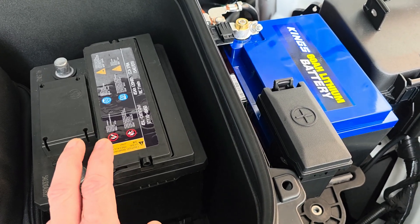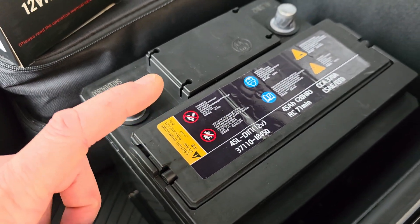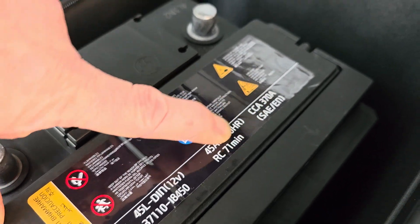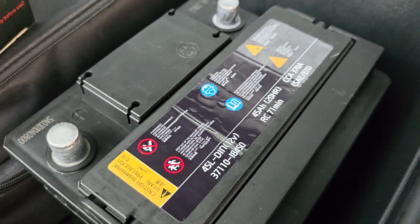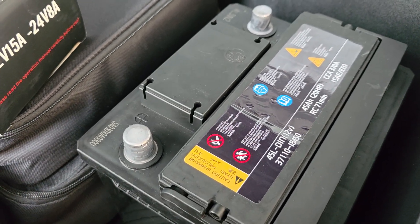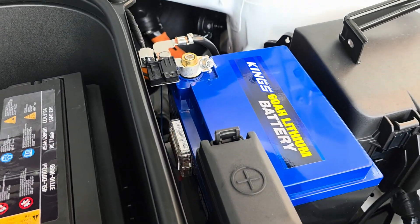A couple of days of abnormal behavior to drain a battery well beyond its ability to keep the car going — not good enough for me. My original intention was to replace it with an AGM battery. As you can see, the original battery is not AGM — it's a very inexpensive, small, low-capacity lead-acid battery. It's only 45 amp-hour, which is pretty dismal, with 370 amp cold-cranking. The AGMs were about 55–60 amp-hour, so I was basing everything on that. Then when the battery failed at the detailer, I thought that's it.